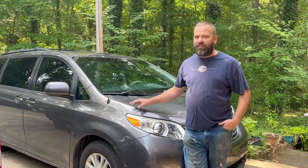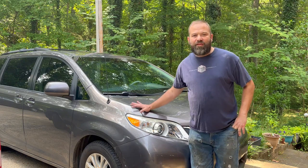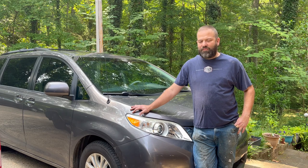I'm making another video on doing maintenance on my wife's van. Most people watching this video don't have any experience working on cars at all. It's a very simple process, you just got to have a couple tools. On this particular van you got to have a special socket for pulling the oil filter off — this van has an oil filter canister. I'll put a link to it in the description. The van uses 0W20 full synthetic motor oil. I'll also go over how to reset the maintenance required light at the end.